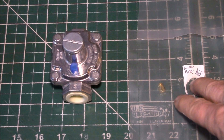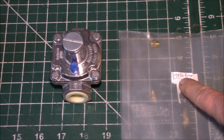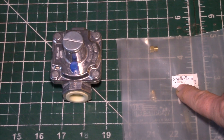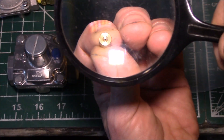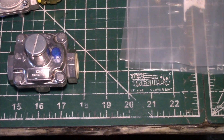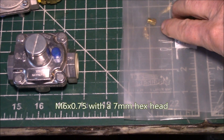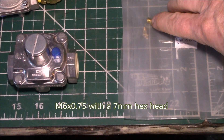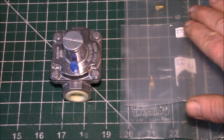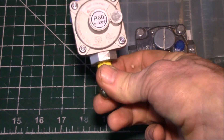The 0.65 millimeter went up to a number 60 size, and the small burner had a half millimeter that goes up to 1 millimeter. He's got them all chamfered. I'll have to try those out to make sure they're the right size — they should be M6 by 0.75 millimeter thread pitch. So those are larger orifices for natural gas.